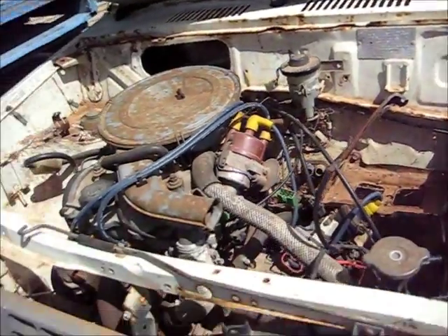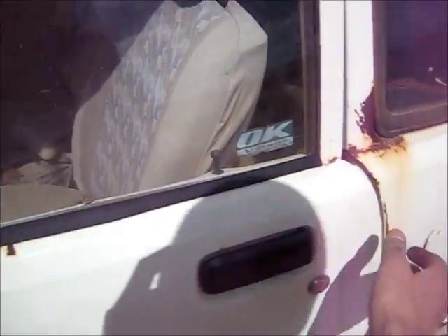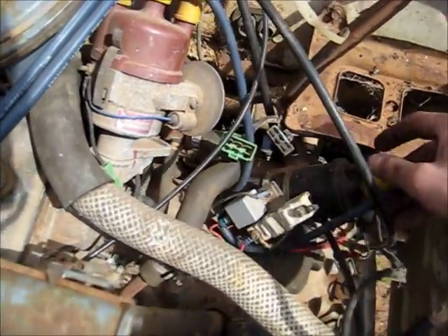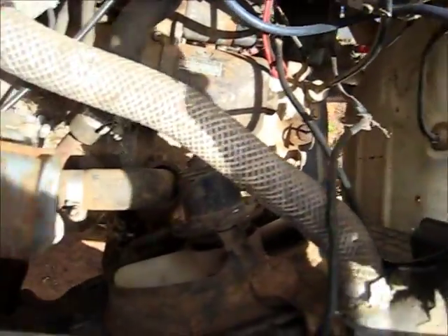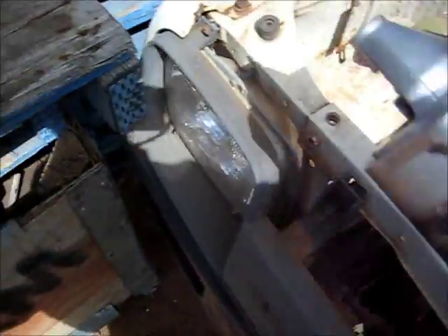This is definitely a modern starter motor. I've got a Nippon Denso one the same size - I'm not sure if the bolts are the same. This is a genuine Mitsubishi starter motor. What I hate about modern starter motors is they're all throwaway - they're not really meant to be rebuilt anymore, which is pretty sad. The Nippon Denso one sits at a slightly different angle - the mouth where it opens to the bendix is different - so damn it, it's not going to fit. Nippon Denso is good quality stuff though.